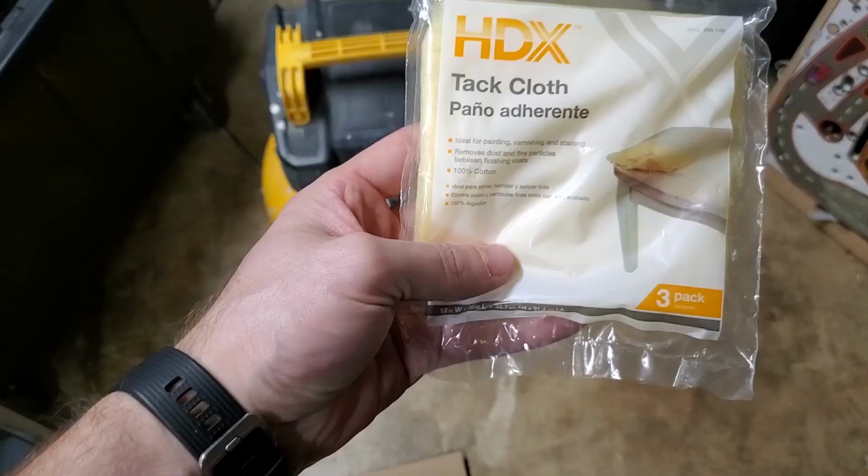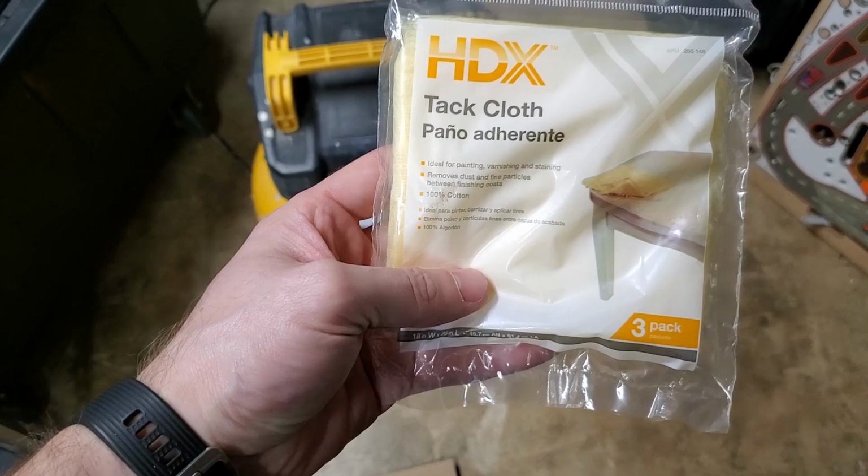So you need to mix it and then pray that you've got everything ready to go with no stop, no issues. That's not the case for me here, guys, because I forgot a very important step in the preparation process before you clear your playfield. You can see me as I start to use the tack cloth to make sure I get any possible last bit of dust or dirt that could have fallen onto this playfield. And then I notice that I forgot to put some 44 bulbs into my GI sockets.